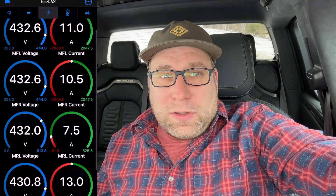Right now I have the CAN server hooked up to two of the several CAN networks that I've found, and concentrated on motor and battery pack data, which includes several dozen signals: torque, power, current, temperatures, as well as the same from the battery pack. You can look at them live within TESLAX, which is the easiest way to do it, and of course you can always log things with CAN server and bring them down to your computer to analyze later with SavvyCAN.